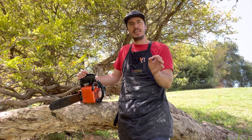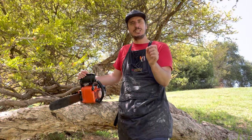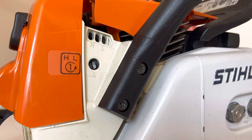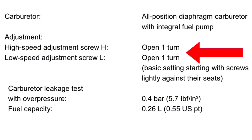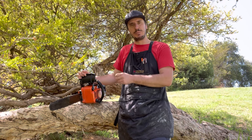The first step is to set your carburetor adjustment screws to the manufacturer's recommendation. These can be found either located on the piece of equipment itself, or if not, you can go into the service manual and it will tell you how many turns out from lightly seated. Stihl call this their base settings in their literature, and it's the first step to their tuning process.